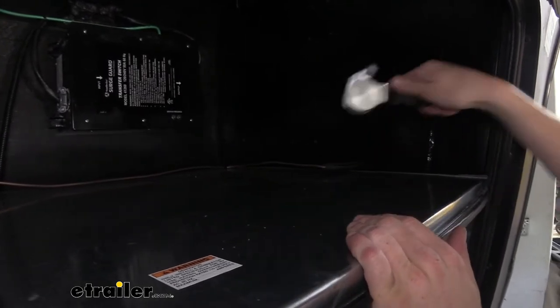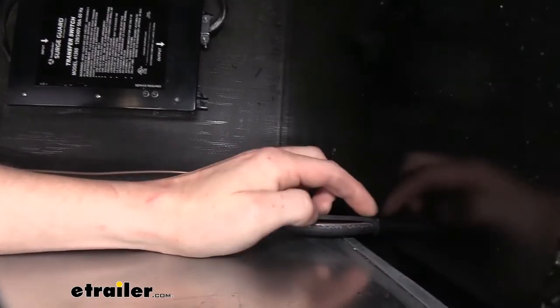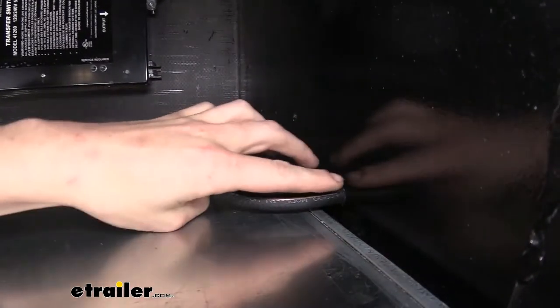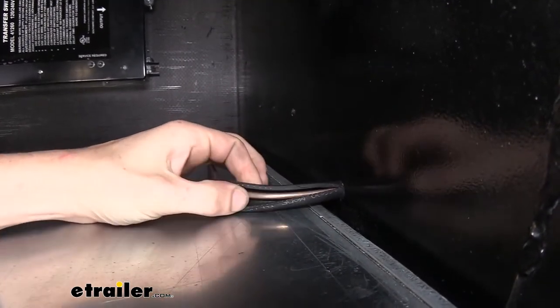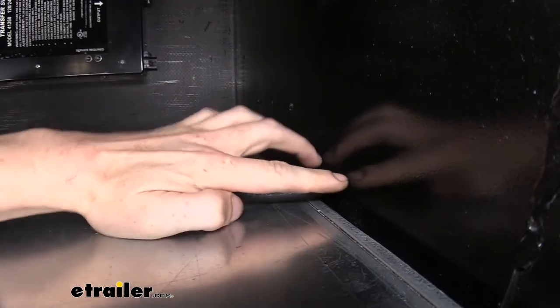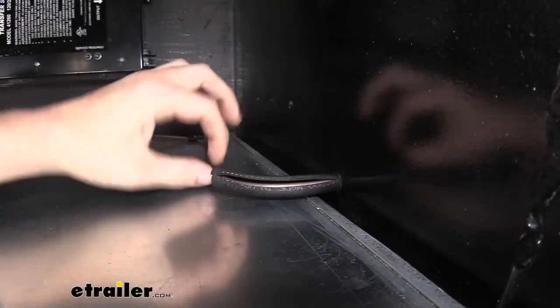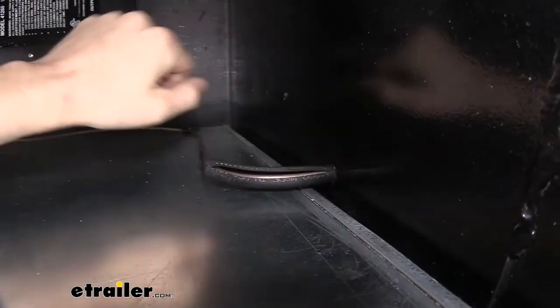We use the line bender again here to turn it and go out the hole we had drilled in the side. I drilled a half-inch hole — this is where I was able to poke my line through to pass it through. You can see that 90-degree bend there. I took a piece of vacuum line tubing, slid it down the middle, slid it around the hose, and pushed it through the hole. That's going to prevent our line from rattling or touching the metal surface where we drilled out the hole.